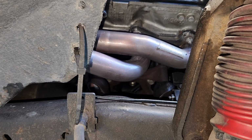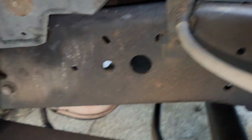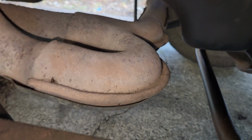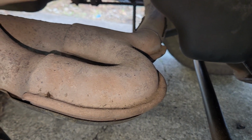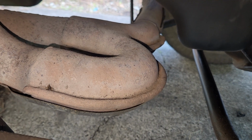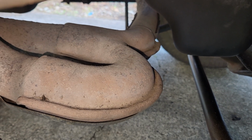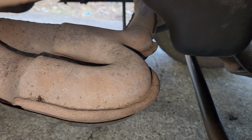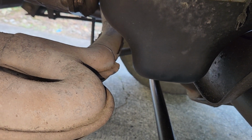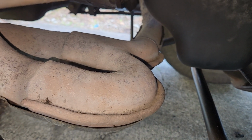See, there's the headers in through there. Down here, this circle return, that is a choke point, and that is what's going to be replaced with my Y pipe kit. Gets rid of 2 exhaust pipe reductions in there, about 1.5 inches inside. So you get rid of those, it creates a straight line instead of a 180-degree curve, and it's supposed to be one of the best performance conversions you can do on one of these 5.4 liter F-250s.